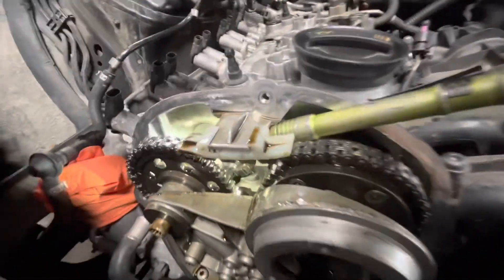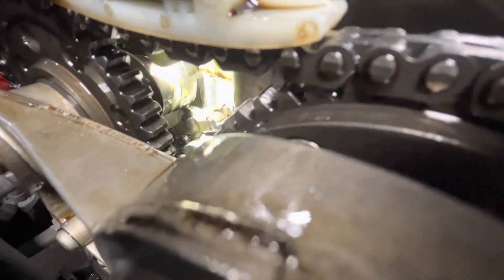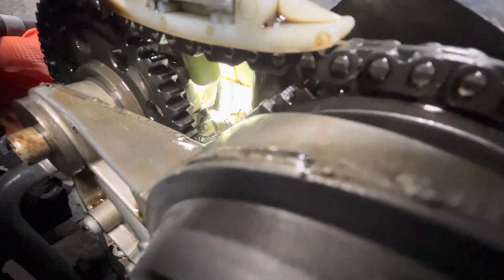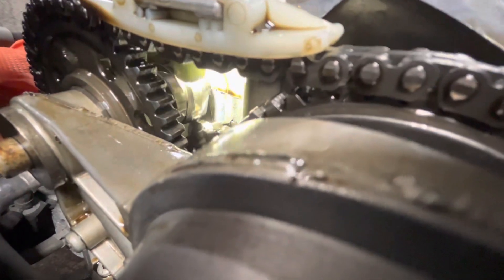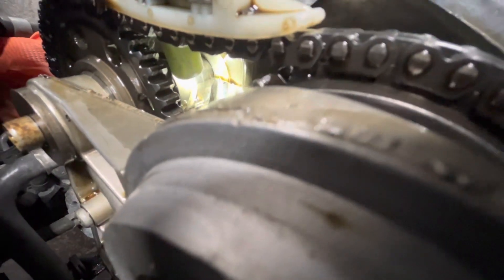So you have a good idle and everything else. Pretty cool setup. You can see the rocker in here — it's just a roller rocker, and it's totally fine with that little bit of side motion. Right now cylinder one is on the peak of the lobe; you can see both lobes next to each other. It actually looks like it's on the higher lift, depending on how the car was shut off and where it was at the time.